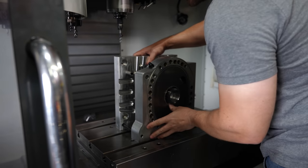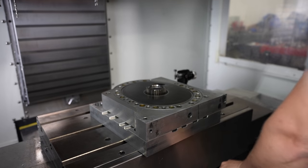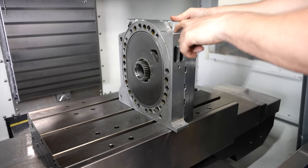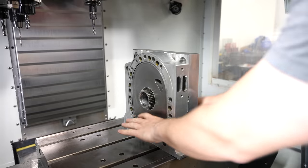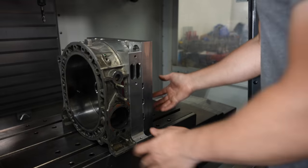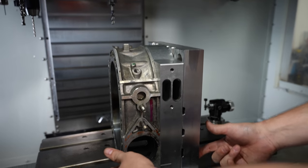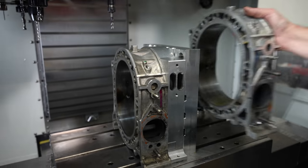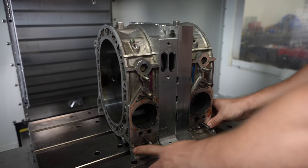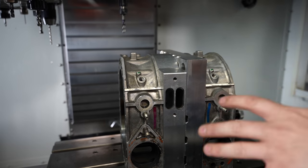Let's see how accurate it is on this side too. Those are brutally accurate. Right now if we were to take this, even held up like that and machining into this area, it's still asking for problems. Let's brace it again on each side. What better than a jig that already exists? We'll bolt that one to that side and now this is sandwiched between these two, and we'll get some long bolts that go straight through all this dowel and the rest of it. We'll basically build like a weird mini stack, have the dowels go straight through here, and then machine this so you can't really mess up from a vibration standpoint. This is about as good as it gets.